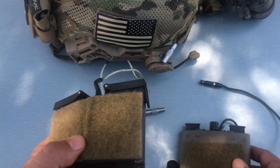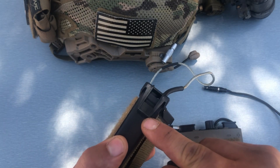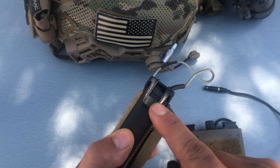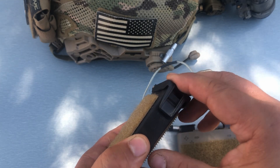As well as the battery tray lids here, as you can see where the latch goes. You can tell how over time, once this thing locks in here and you have to pop it out, when these become brittle there's going to be a better chance of these breaking. And then you're not going to have good contact here with your battery with the pressure pushed down on the battery tray.